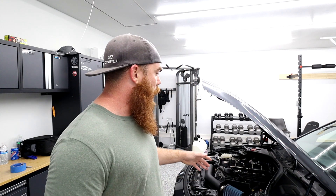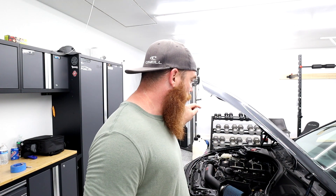Hey guys, welcome to Force Induction Studios. My name is Chris and today we are installing the high-pressure fuel pump — it's a Spool 150, actually got it from a guy on Facebook who purchased it and then didn't use it. This is actually the second time I'm doing pretty much the same project because I installed the port injection, and it's pretty much the same route you take. On B58s the fuel pump is actually under the intake manifold, which is far away.